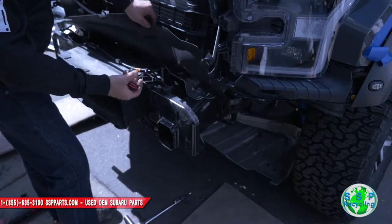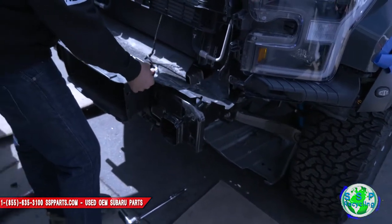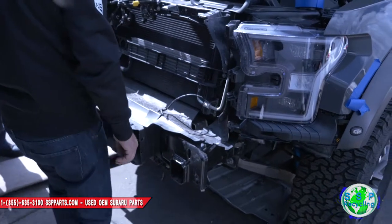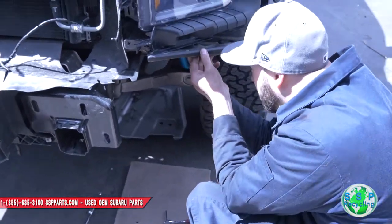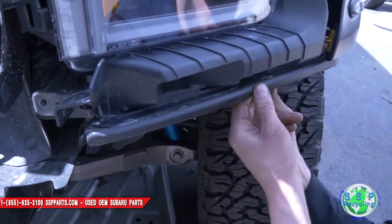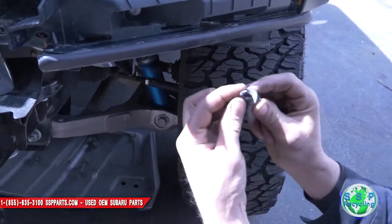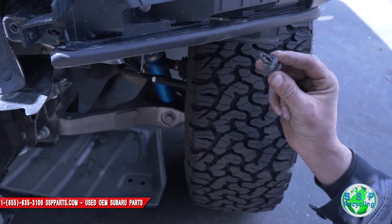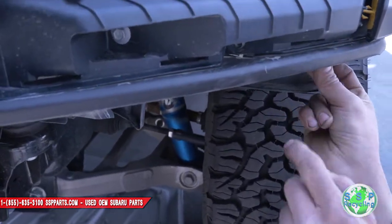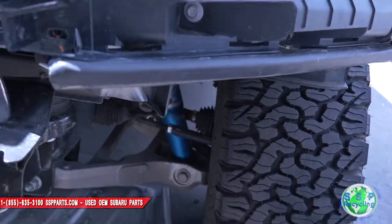That's the radar sensor — we have to relocate it. I'm thinking it'll come right through here, and I'll plug up here, and at least leave that alone. There are little plastic clips — I think there are four of them. You just take it like this, make sure it's all the way out so it'll push back in, find the hole, slide it up, and push in. Now your rubber seal is back on.